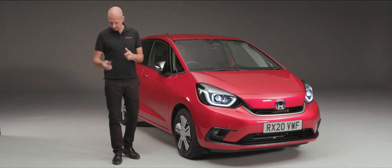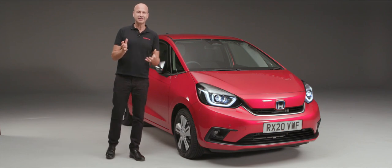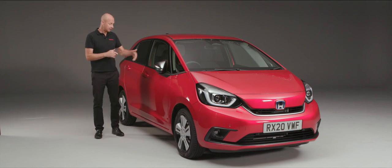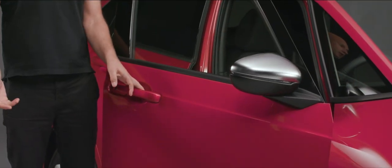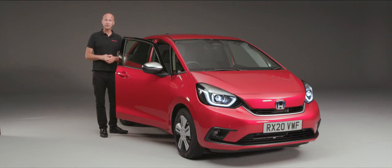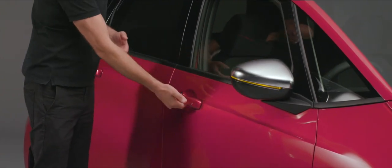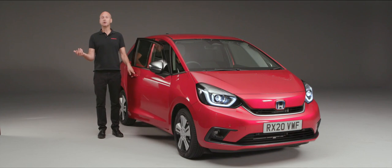There is a second way using the keyless system. Put the key in your pocket, handbag, jacket or bag — wherever you like. As long as you're in proximity of the car, all you need to do is put your hand behind the door handle, you'll hear it unlock, and you can open the car with the door mirror unwinding. To lock using the same system, there are three little ridges on top of the door handle — make contact with those to lock. After a few seconds, put your hand in again and it will unlock the car for you.